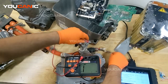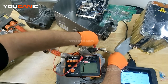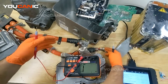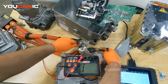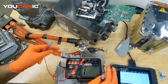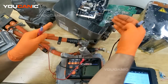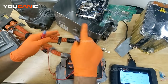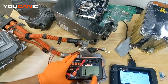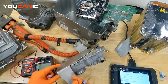You can also test the cables themselves. Connect one lead to the cable and the other to a metal piece on the chassis — you're connecting high voltage on one side and low voltage ground on the other, sending 500 volts across. There should be very high resistance; that voltage should not pass through and complete the circuit back to the meter showing zero. If it shows zero, you have a problem.